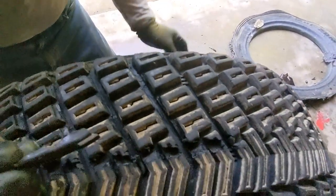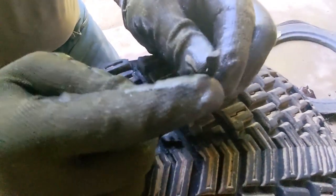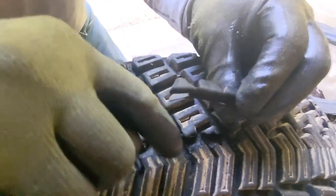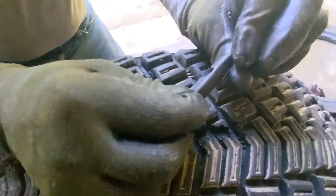We did a trial earlier. When you cut too deep, you can cut below the line of the tread, and then you are going to end up in the carcass of the tire. That's too deep — you don't want to cut that much.